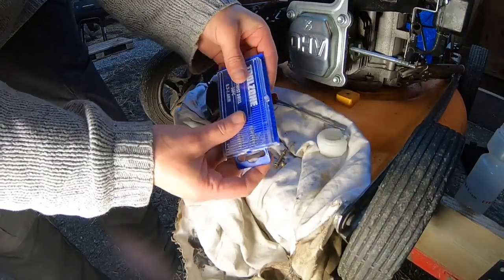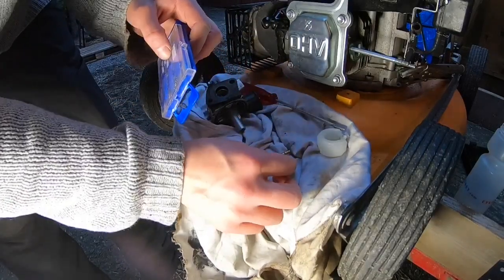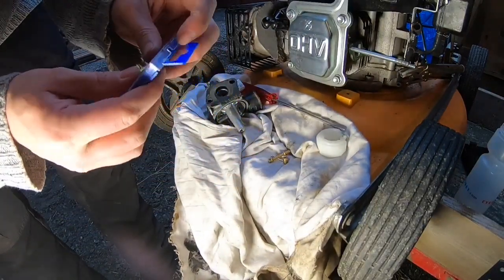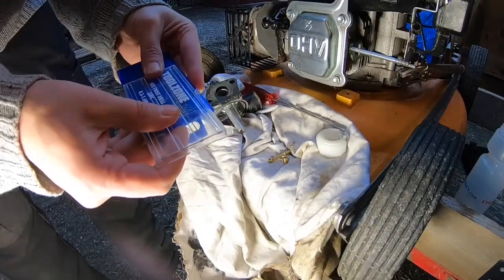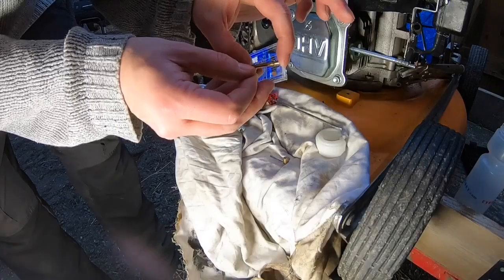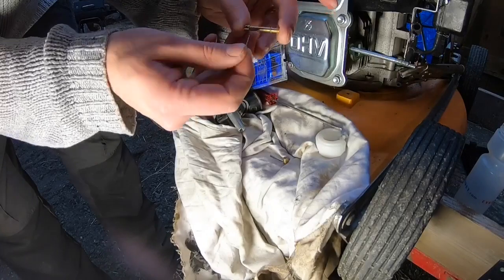You can just slide this to what you want. I don't know what size this is, but it's these, the small holes here, see here. Make sure they are 100% clean, and this is the main jet. Should also be clean, and that Honda, it looked clean, but it didn't run until I got these and just manually cleaned them. On the Honda I couldn't find information regarding what size it was, but I just took a guess at this one, and it worked very well.